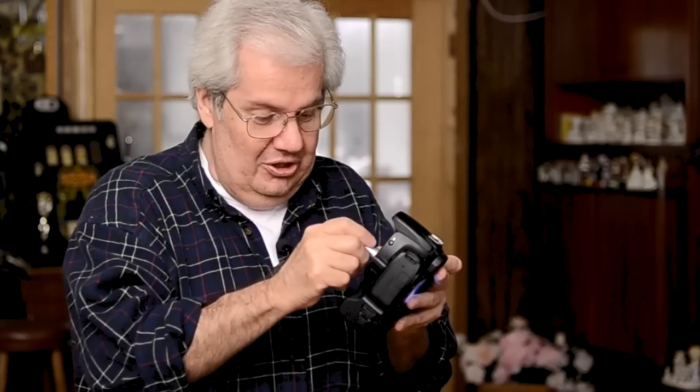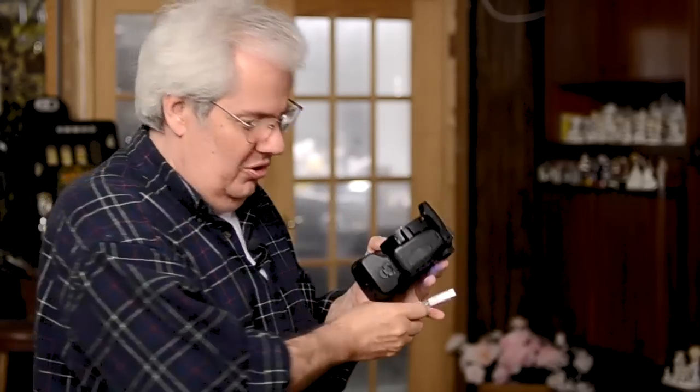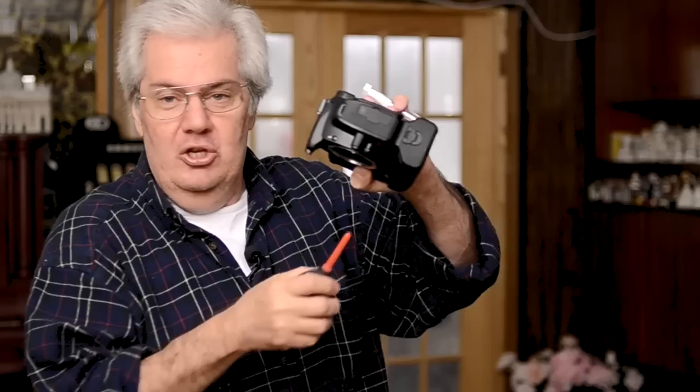When you finish cleaning the sensor, don't discard it yet — but don't use it again on the sensor. You don't want to use a contaminated one in there. Then blow out any loose dust you've loosened that's still sitting in there. Turn the camera face down and blow it out really well — angle it left, right, forward, backwards to get the dirt out of the corners. Blow it out nice and hard until you get all the dust out. Then put the lens back on, and you've just cleaned your sensor yourself without sending it to the camera company.